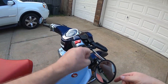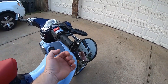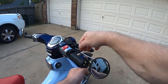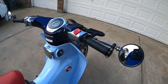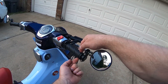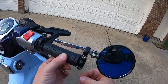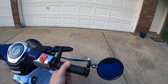Plan A was shoving a screwdriver in there. There are two little ears you can try to grab from the outside edge. I mangled them, broke one ear off, beat on it, and finally got one side out, held it there with a screwdriver, grabbed another screwdriver and levered and torqued the heck out of it until the top one popped loose. I pretty much destroyed the little locking assembly, but I don't care because I'm not using it anyway. Once those two tabs are released from the indents in the bar, the weight assembly slides out and you can put the insert in for your bar end mirror.